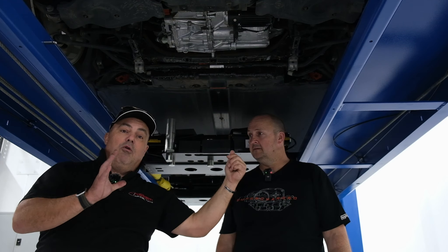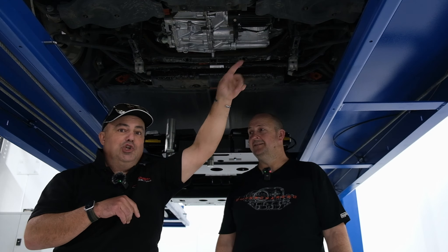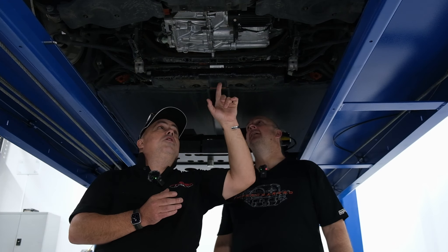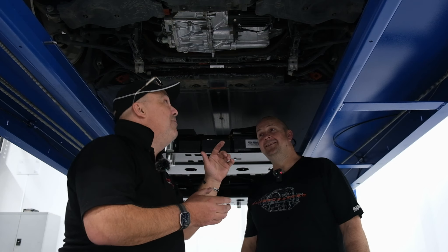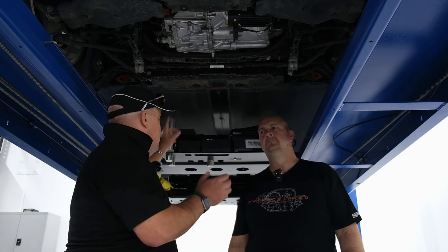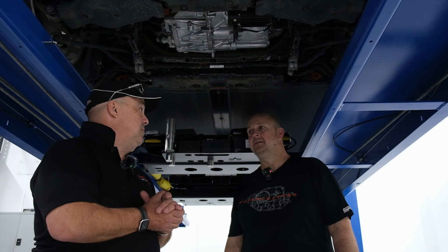Because it has a final drive inside — a crown wheel and pinion, a differential — and the differential requires lubrication. What Tesla do is they don't just lubricate the gears; they also pump oil through the stator with an electric scavenge pump to cool it as well. That oil is cooled not only by the DTEC EV enduro oil cooler system, available from Unplugged Performance in Hawthorne, California, but it also has a refrigerant heat exchanger on the oil system. The air conditioning controls the oil temperature, and there's also a water and refrigerant heat exchanger, and that water goes back through the battery as well. This brings the power output to 400-odd kilowatts.